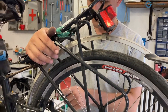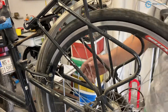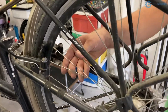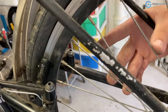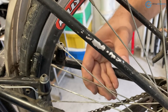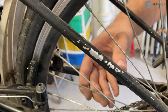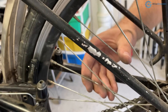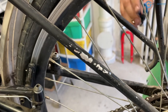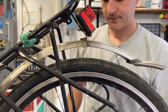The first thing I'll check is whether the right-hand side spokes are a bit less tight near the problem section. I'm feeling the spokes by hand near that area — it's not very precise, but I can tell if they are in the ballpark. And no — there are no loose spokes.